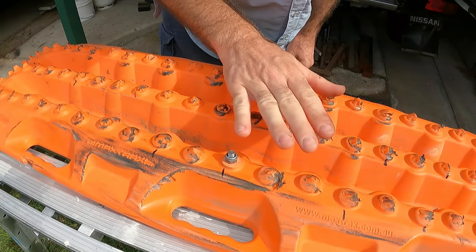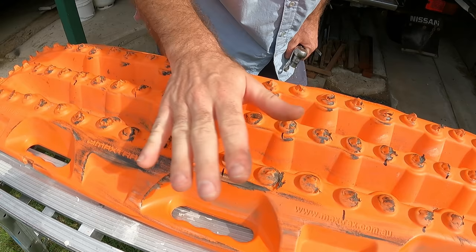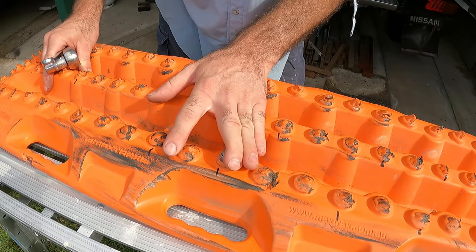I'm pretty sure that thread is going to be a little bit too long. I reckon I'll cut one mil off the thread so it's sitting out of the nut maybe about four or five mil. Already you can feel just with your hand the increase in traction - just that one bolt will bring it. Fantastic. Right, I'm going to get to work with the other ones.